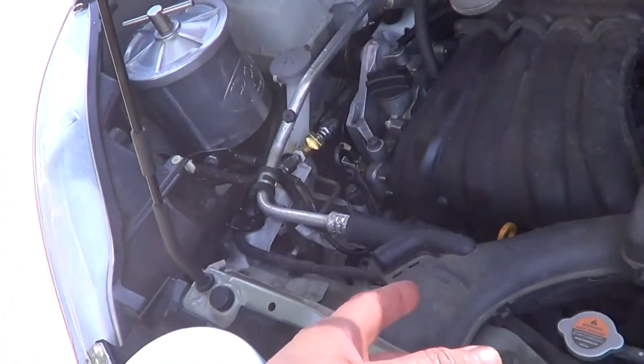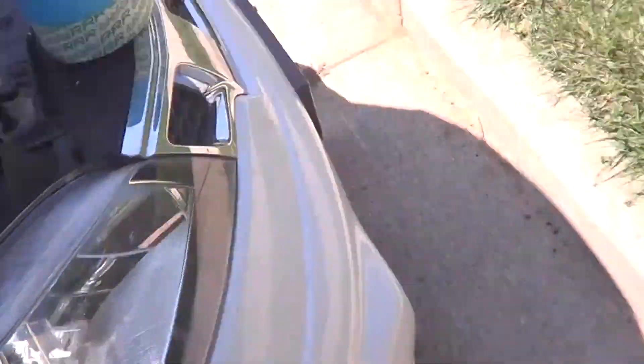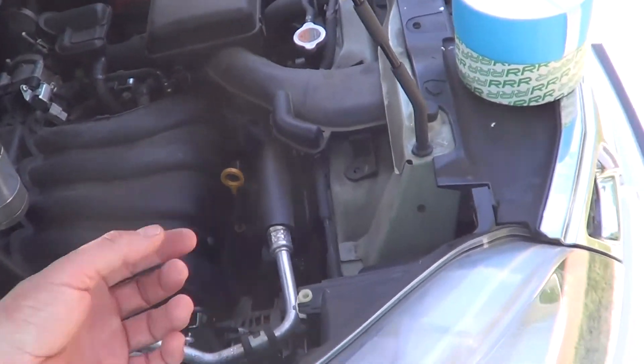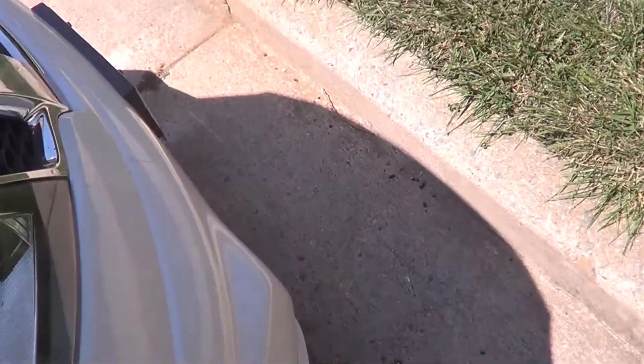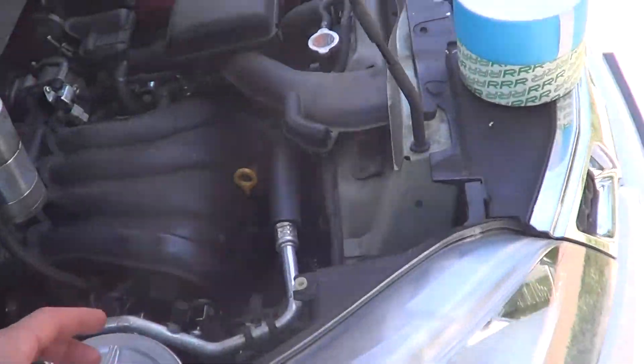I have a high-quality main filter, which is very small for this engine, but the bypass didn't seem to make the oil any cleaner — or just barely cleaner — which was still very clean oil even though it looked dark. The particle counts were showing clean, but I wanted to be able to see a difference, and it's like that one really wasn't doing anything at all.